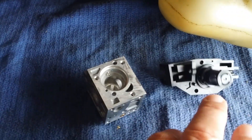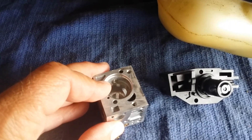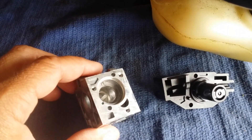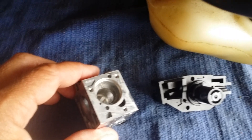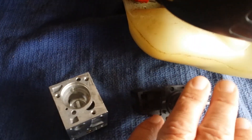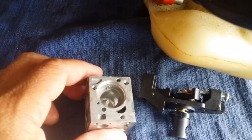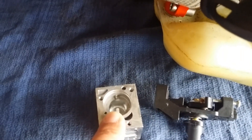It lifts the pin out of the jet to let more fuel in. How it lifts as it turns is the roller that's supposed to be in that little pin right there. What I had done — just messing with the carb, I took it out and I was putting the roller back in, and in the course of putting it back in, it just slipped and is currently somewhere under my feet in my garage. What was going on without the roller in there was it was running fine at first, until the throttle body started wearing out, and I developed a flat spot.